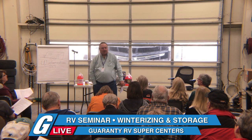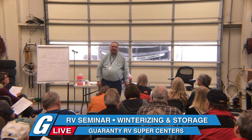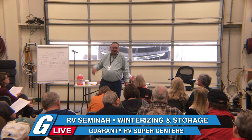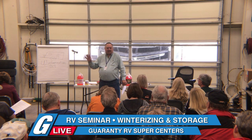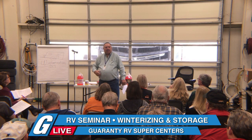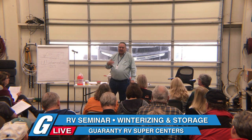So you need to come to our RV Basics seminar and we'll explain all that. But what we're going to tell you is, and no, Happy Camper isn't going to pay us to endorse their product. But for those of you who come all the time, Dave's always pitching Happy Camper. He likes to talk about poop and he likes to talk about Happy Camper. So the problem is, for your coach, you have a little foreign material, some organic or tissue debris on one of your probes for a monitor panel, and it's stuck there. And the only way you're going to get it off is to, and you don't do this at the time of winterization, you do this in the spring, and then you use Happy Camper every time you go out.